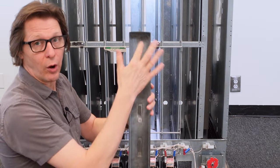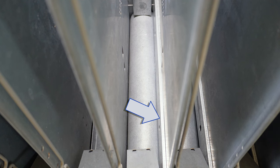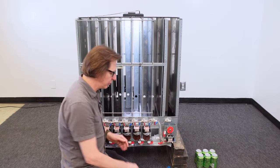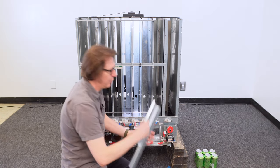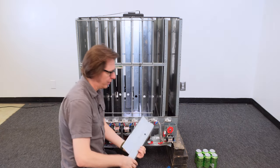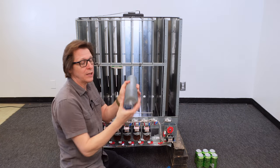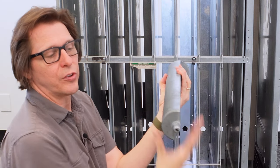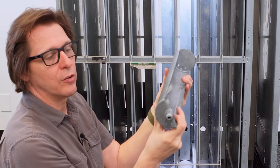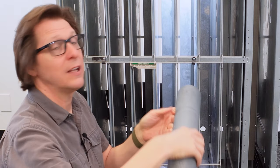We're going to need to install that rod into the cradle. But first we need to get the bottle shim out. This can actually be the most difficult process because there's a little shelf on the shim — much like the 12-ounce can shim — so you just can't pull it out if the cradle is in an upside-down state. It gets hung up, so we need to rotate the cradle to what I'd call a half-moon shape so we can pull stuff out from the cradle.